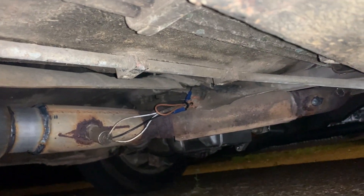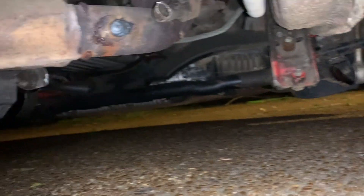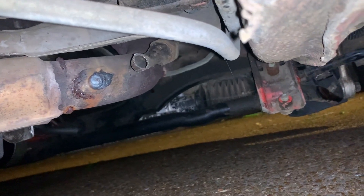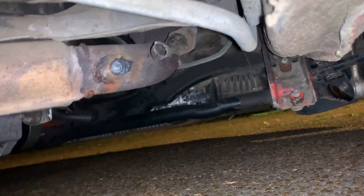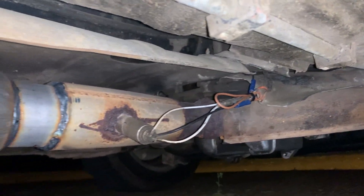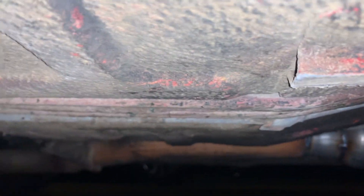I had the exhaust work done — some of it. That stayed the way it was up there except he cut the EGR valve where that tube comes out and patched it at my request, just because the upper end of it wasn't connected to anything. He put a standard stainless pass-through muffler in there. It's still kind of loud. I'm probably going to want to quiet it up a little bit more. I think I'm just going to let it go for a few days.